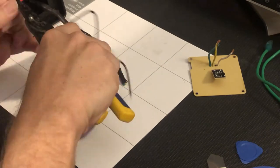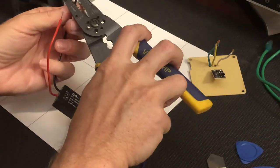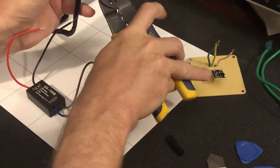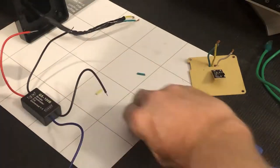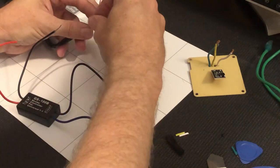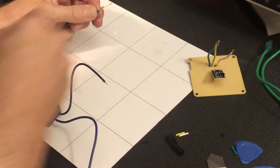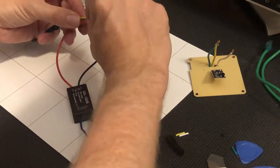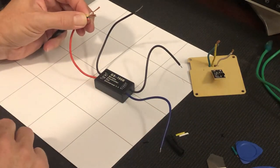Do the power control first. And hold on, keep the lead run through the trailer hitch because I'll make a plug for it later. This needs to be done while that trailer hitch is in place. So as I said, I can't find any reason why the yellow and green leads should be dealt with separately. So I'm going to take them, which is the power side, and connect them all to the positive side of the strobe controller at the same time.